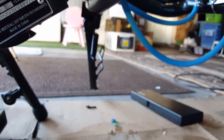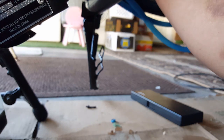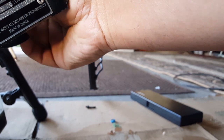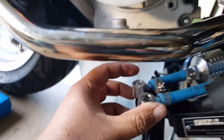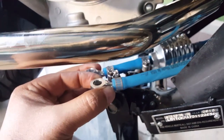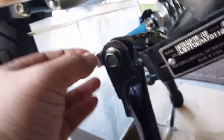Both are coming in here like this — they're level. Don't worry, as long as the banjo bolt is level you can put the bolts in from any side. You can rearrange it to come up from any side right here. It's probably going to have a lot of tug on it, so I'll put a little tie strap there to actually relieve the pressure from the two halves being tugged against each other. We'll do that after we go and test this out.